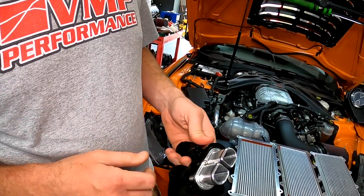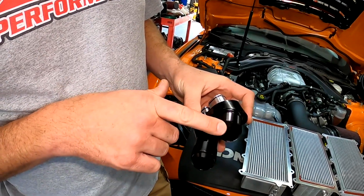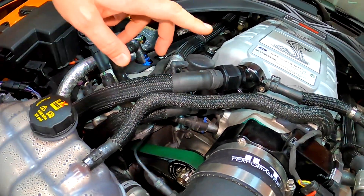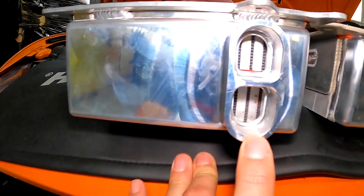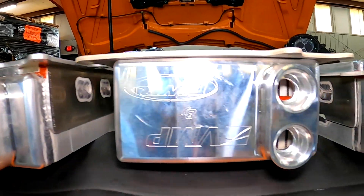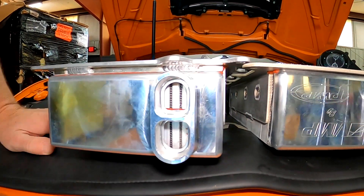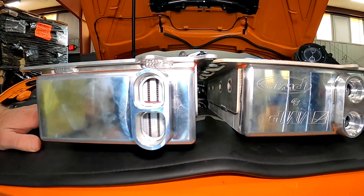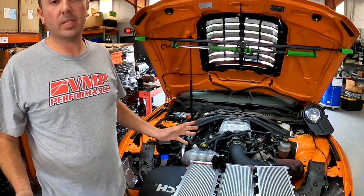The cool thing about this AN fitting is it's completely modular. We have a part that you can change out for the stock round ports. You can run 16 AN to one inch fittings or 16 AN to three quarter inch fittings if you have not yet upgraded your factory coolant lines. If you look through this D-port you can see how much of the core is exposed versus the stock style — probably another 30 percent increase in surface area to reduce the water side restriction. The more water flow you can get through it, the more efficiently it can cool and carry heat away. With intercooler cores, you want as much water flow as you can get — you can never have too much.